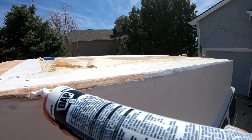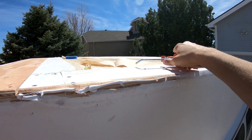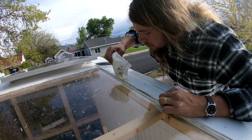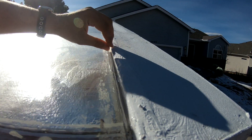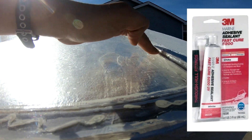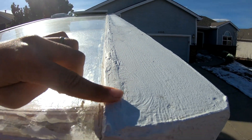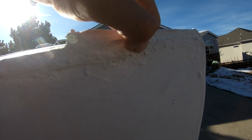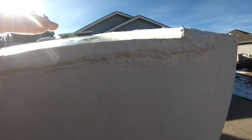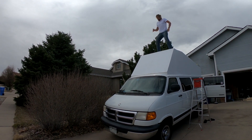I'm doing the same as all the other edges — sealing the seam with caulking and rubbing the caulking into the grain, because that's where you're going to have the most water problems. At the start I had some minor leaking problems, so I chemically welded on another acrylic rod right on the very edge, then filled in all gaps with a marine-grade adhesive. Ever since I did that I haven't had any issues. The marine adhesive allows it to still expand and contract while maintaining a good seal. This is me doing the jump-on-the-roof test and it's passing just fine.